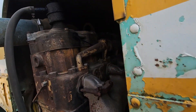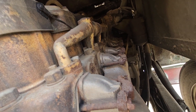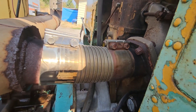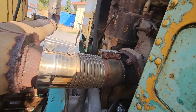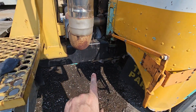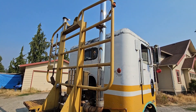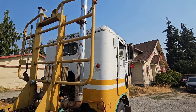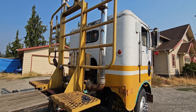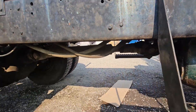I'm going to pull the manifold off - you can see that almost every port is leaking. I can hear it when I drive it and it really bugs me, I hate exhaust leaks. This transfer piece from the 4-inch to the 6-inch looks goofy so I'm going to ditch that. I'm trying to find the factory stack mount and the factory air intake mount to put back on it and ditch all this. Probably put just a little short turn-out right at the top of the cab. I want to keep it old school - no crazy big pipes or anything. Everything's looking better and not so greasy anymore.